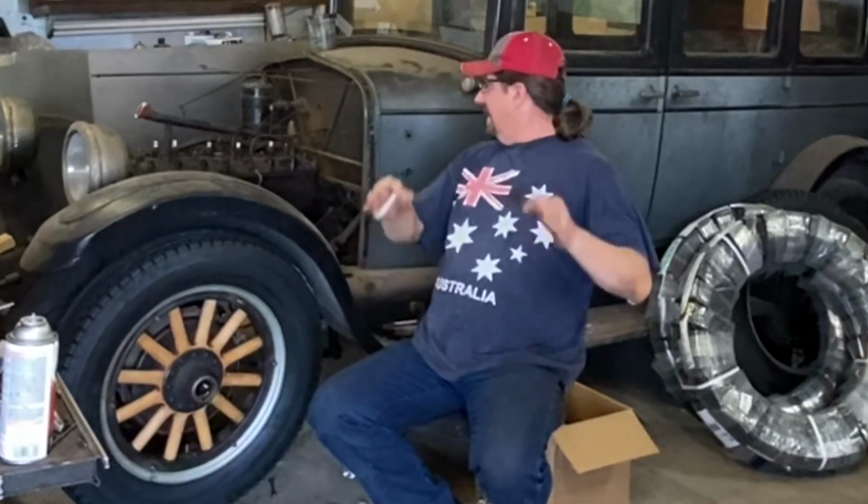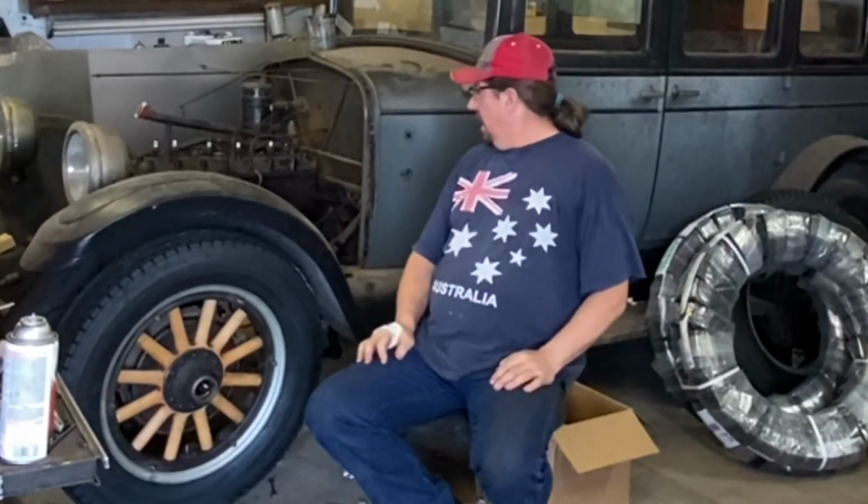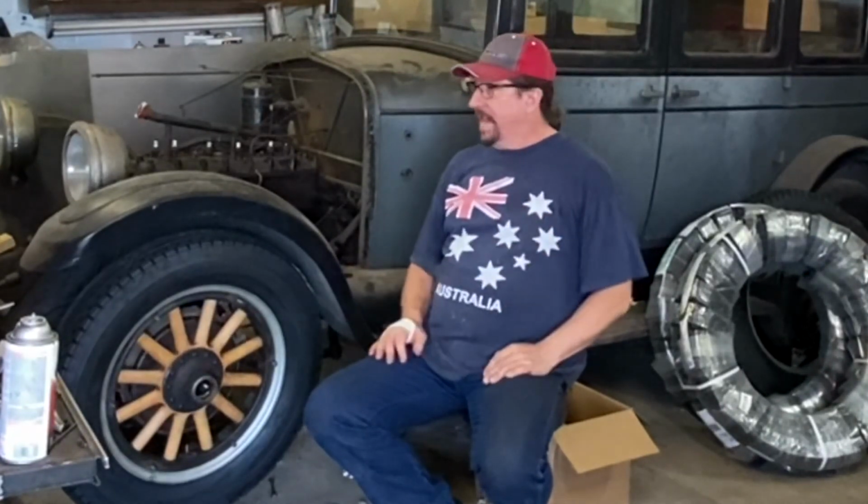And then of course there's a T at the very top where it tees into the oil pressure gauge in the dash. That T is still on the other oil filter. So once the new oil filter gets here, I'll determine for sure how it needs to go, and I'll probably make a quick phone call to Wayne Koffel just to make sure that I'm correct on my assumption there. I may have an oil flow diagram in my books.